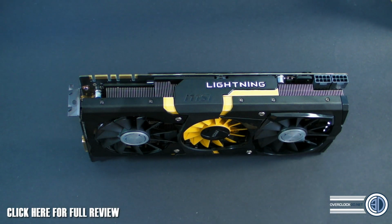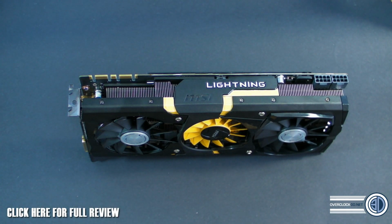But anyway, we've made a rather lengthy bit just having a look at the card itself and some of the settings. What we'll do now is have a look at it in the rig, so you can see it in there. I'll show you the lights, and then we'll move on to show you the extra settings that will appear in Afterburner, talk about the offset clocking, and then also the GPU Boost 2 overclocking, which obviously the card will do itself. So whatever you set the offset to, it will go up even further from that anyway, which is something a lot of people don't realise, and I'll show you how to check that yourself at home in really easy ways that you can double check everything. But anyway, I'm going to shush and let's get on and actually see this card in the rig.